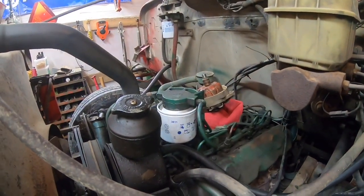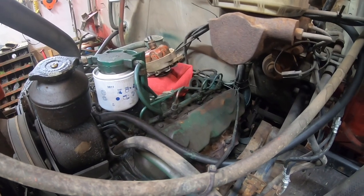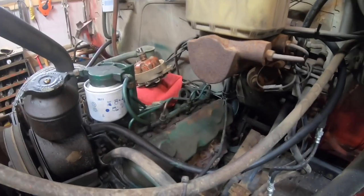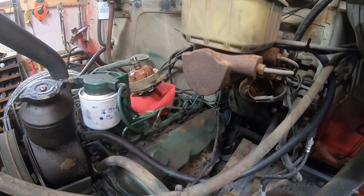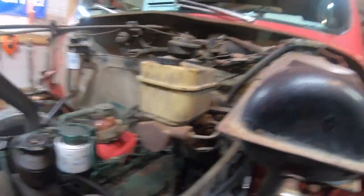What I've got done so far - I took a hose and blew down into the little valleys where the glow plugs are, tried to blow all the debris out and make sure they're clean before taking them out. After I took my breather off, I put a rag over my intake with some weight on it so it can't blow off and let stuff down into my intake.